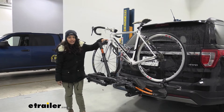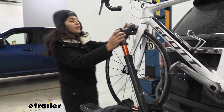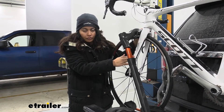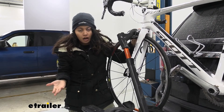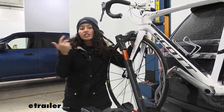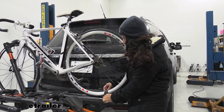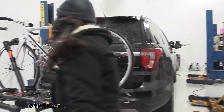So let's take a look at the way our bike is mounted to this bike rack. In the back, we have this rear wheel strap that's holding down our wheels. And then in the front, we have this front wheel mount. I like pretty much any bike rack that has a front wheel mount because it makes it so much easier. For example, if you have a carbon fiber frame bike like what we have here, this means you're not worried about warping or cracking your frame like you would with other traditional bike racks. Also, if you have alternate frames — women's bikes, children's bikes, step-through frames — having this means you don't have to get a frame adapter bar. To take the bike off, we'll start at the rear wheel strap: press this lever, pull up on that strap, and move it out of the way so it doesn't get caught up in our spokes.